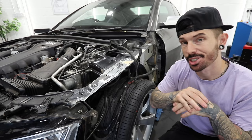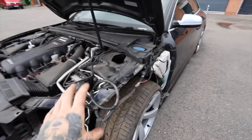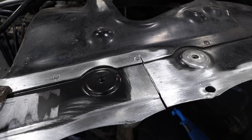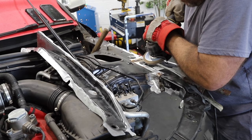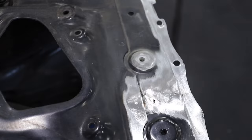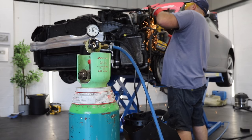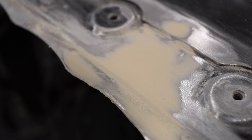Right now we're ready to pretty much put the car back together. Me and Mark carried on cracking away at this quarter panel and this is exactly how we got to this stage. As you can see that part of the car was pretty drastically damaged - it's part of the chassis. Luckily you can buy this part directly from Audi. Instead of replacing the whole part, we cut off the damaged section and welded on the new part. Once Mark welded the top part on he could weld on the bottom part. We have to make sure this is absolutely bang on because the wing actually bolts to it. With a bit of cleaning up and a bit of filler over the top you would never have known that was cut and welded back together.